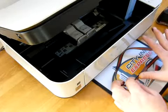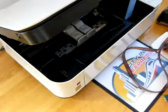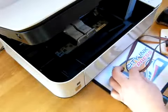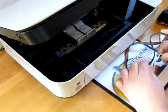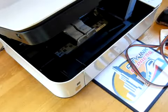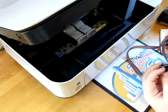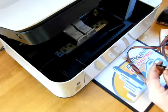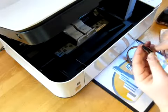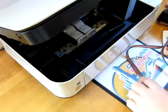It needs to be 22.5 centimetres from the edge of this clamp on the cartridge here. I think you can see that, the edge of that to the edge of the clamp at this position here. It is all detailed in the manual, so you can see that anyway. So I should have a screwdriver with me, but I haven't, so I'm going to use this needle, and I'm just going to open up the clamp. When you insert it into there, it actually opens up the teeth on the black clip, and that will open it enough for me to slide the ink line into place.